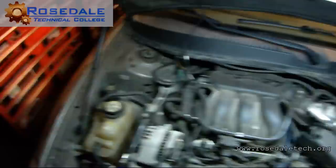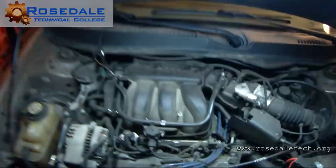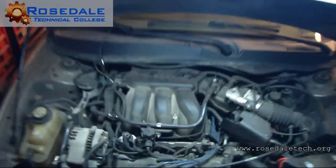And now this test light, I'm not looking for it to light. It's an incandescent light. All that spark is going to do is go right through the bulb and right to the block, okay? And then when we do it, we want two things: one, we want to listen to the RPM, and two, we want to watch the spark. It's actually every so often missing even worse. Hear that? You can even hear it. Now, normally we would start with a scan tool and figure out direction, but we can't communicate with this now, so this is what we're doing, right?